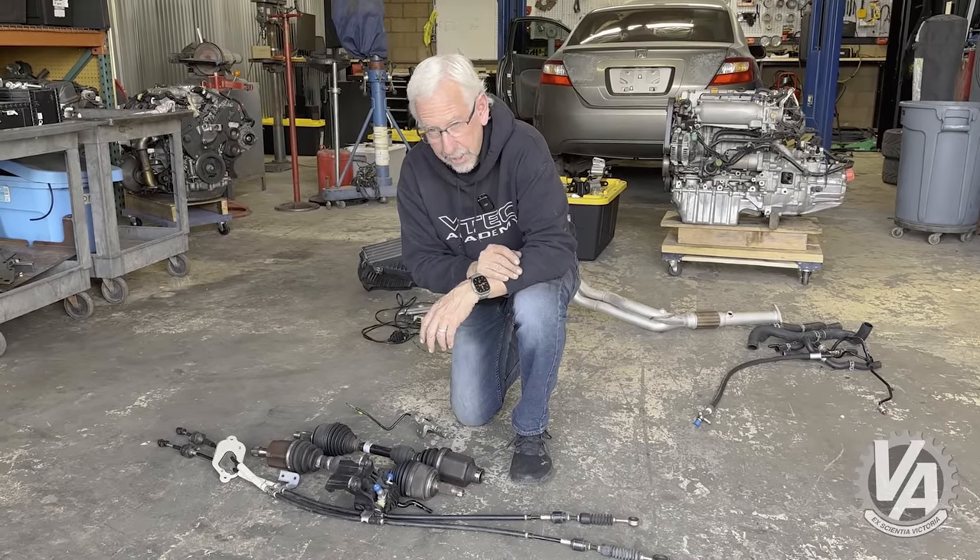That brings us to the electronics. We did have stock O2 sensors — this is the air fuel ratio sensor and this is the secondary O2 sensor. I thought I was going to be driving this car on the street, so I went ahead and got the secondary O2 sensor as well. If you're going to make it street legal, you're going to need that plus a cat. The ECU needs to be an 06 to 11 SI ECU. This particular one is an 06 ECU — I prefer it because it doesn't have VSA integrated into it, so it's a little bit easier to race the car. This one was from a car we built back in 2005 for SEMA and I've been using it in the CRZ. It works really well.